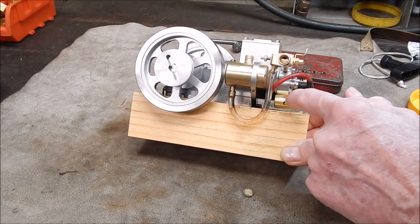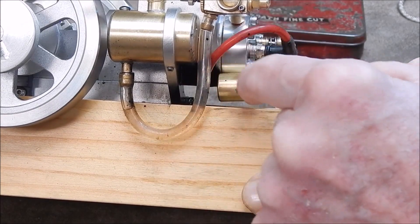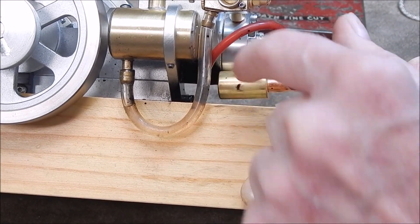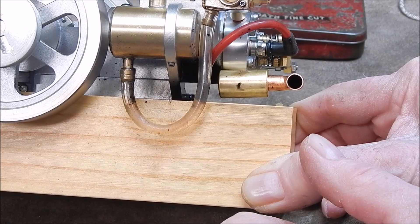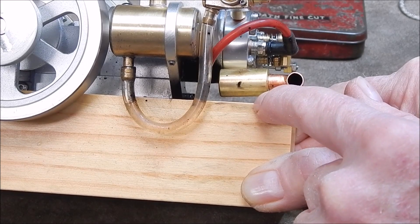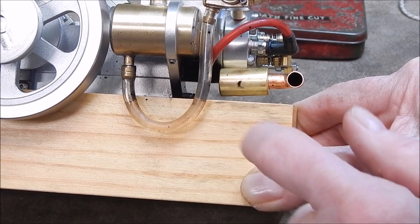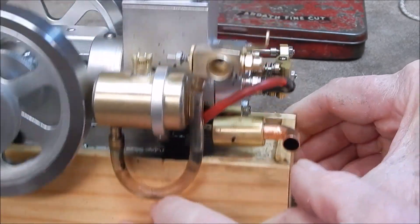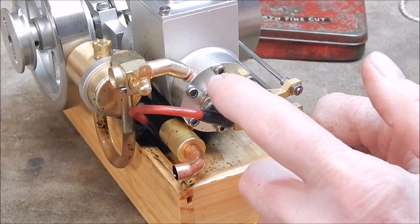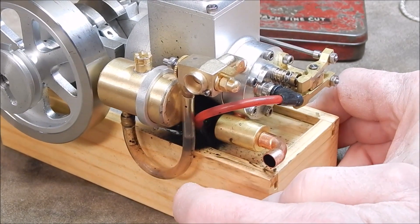So I have to take it off. I'll come in close on it. To do that I've got to unscrew the little muffler. Both the exhaust and the inlet stalks — manifolds as most of you call them — appear to screw into the head. But you can't unscrew it because there's not enough clearance. It won't clear the fuel tank and it won't clear the box. The easiest way would be to take the head off, disconnect the spark plug, take out these bolts, disconnect the rockers, and the head should come off. Then you can work on it and unscrew it without interfering with anything else.